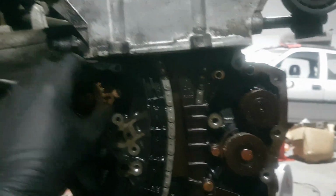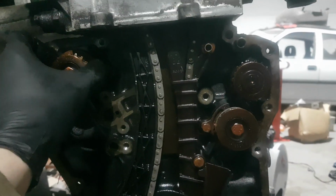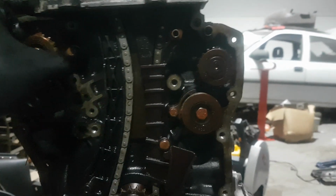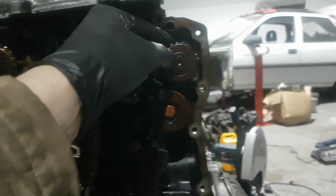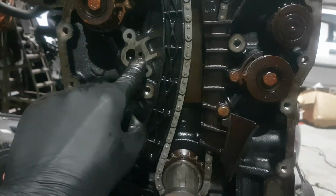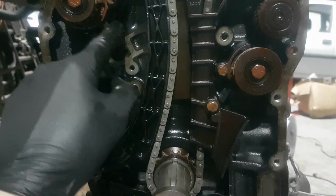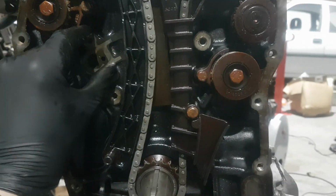Or the better way, the proper way. Nick Chisholm again, like I say, withdraw these balance shafts. Now, on decent oil-changed engines, these, undo that there, will literally just slide straight out. But I've known them where they won't. They're solid. So withdraw that, withdraw that, withdraw that. Nick will send you a grub screw. Either way, you've got to tap that out to blank it off. Or you can get in touch with Aaron Alty. He did actually make a plate which bolts straight across there and seals around it.